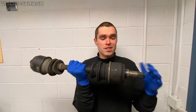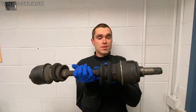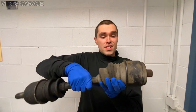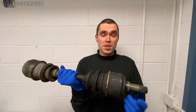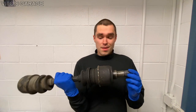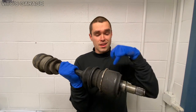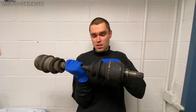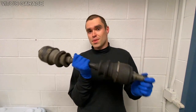As you can see when they age, the boots actually crack. This one's actually split a little bit right here. Overall they're just really old and cracked. So we're going to be refreshing them today, putting new grease in there, cleaning it, and also changing the boots. After that I'm going to paint these up — wire wheel all the dirt and rust off, clean them up, and then paint them. It's going to be really nice.